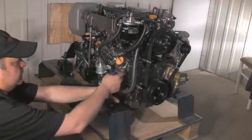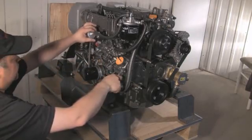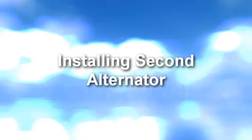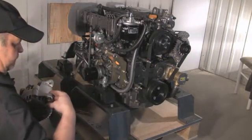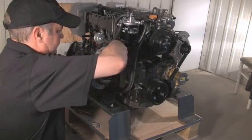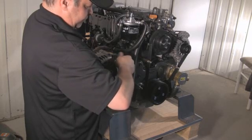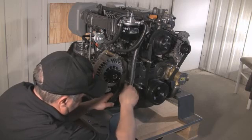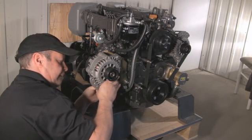The next step is to install the mounting bracket in two specific threaded holes located on the side of the engine. Remove the two bolts, position the bracket over the holes, and install the new bolts provided in the kit. The second alternator simply slips over the three-and-a-half inch spacer incorporated in the bracket. Adjust the spacing at the rear foot to ensure a very tight fit, then push the bolt through the alternator foot and bracket spacer, attach the nut, and hand tighten. In the spare hole at the bottom of the engine, bolt on the adjustment arm that comes in the kit, then using a quarter-inch spacer provided, attach the arm to the alternator and hand tighten.